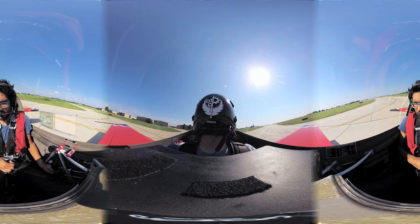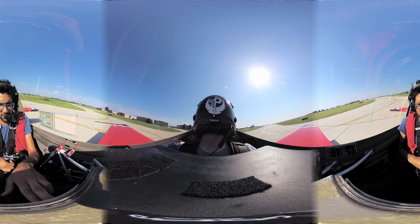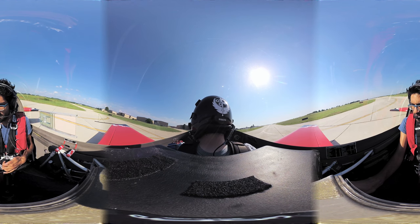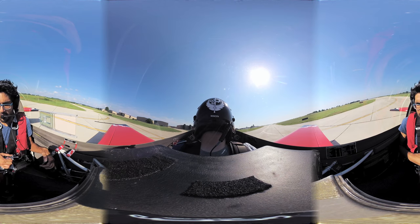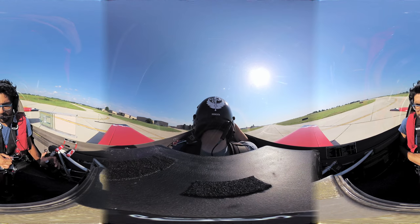It's got back and got a rise in manifold pressure. One, two, three. Looks good. Oil pressure still looks good. We're going to check the mags. That's a 100 RPM drop. The other side is a 110 RPM drop. Good. Mag check was good. Throttle idle check — idle's good. We'll come back to 1,000 RPM, which is about there.